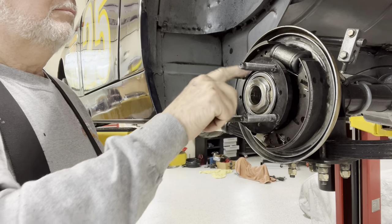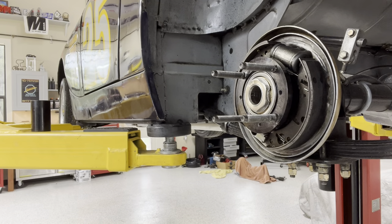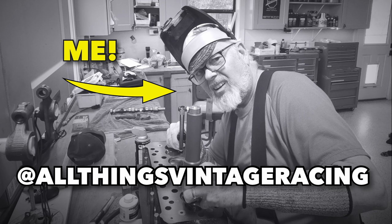If you have a recurring problem here, it could be because the axle tube is damaged or egg-shaped, or any number of reasons. If it just keeps recurring, put a speedy sleeve on and that'll solve your problems. Don't forget to subscribe — thanks, see you next time.